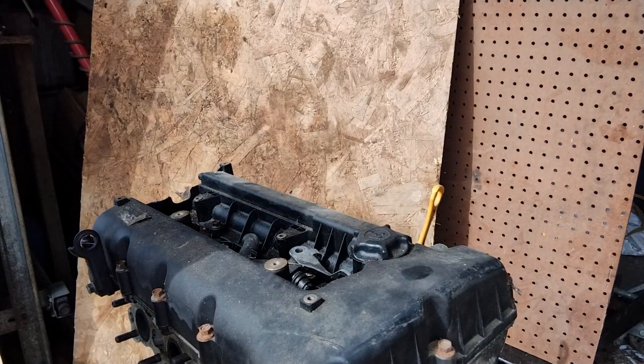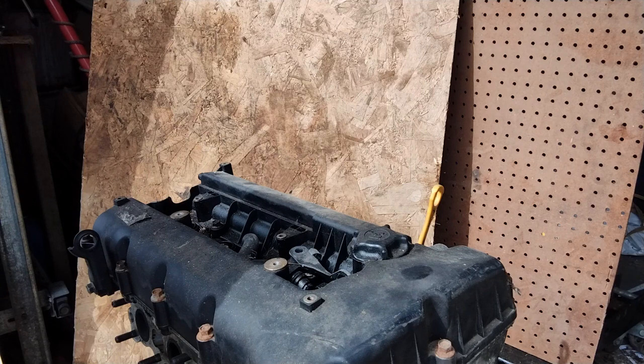Okay, here we have the engine you saw behind me. I think it's a 1.8, the typical Hyundai Sonata engine. I know this has a rod bearing out, but can I get this engine running for the price of a brand new crank, under $200? Find a used rod, put all new bearings in it, and replace the rings, because I'm pretty sure these things die because of low tension rings, just like my 2003 Forester, which I just put new rings in, and I got better mileage out of that one, from 22 to 26. So I'm going to take this apart, take the valve cover off, and I'll bring you back and we'll look at the cam journals together. How does that sound?